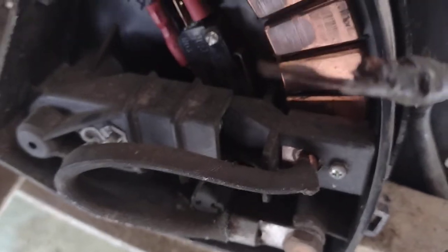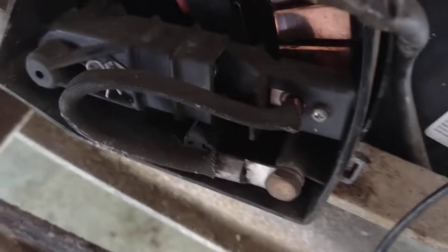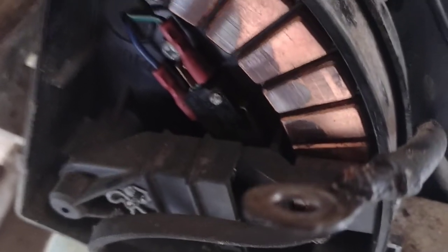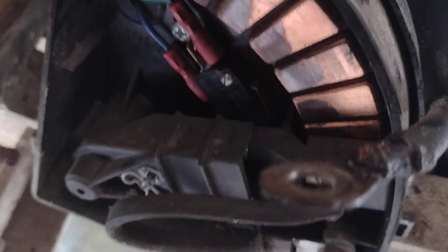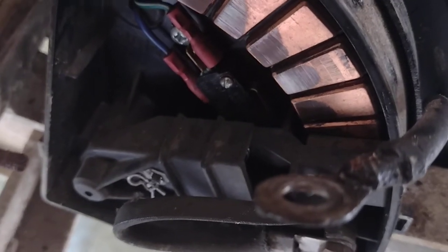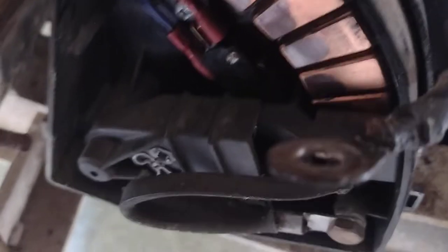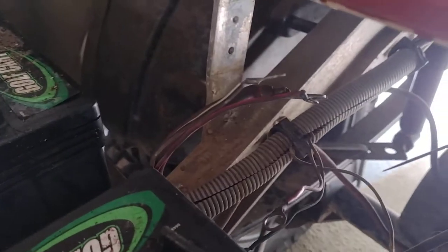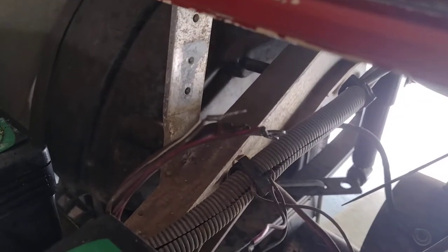...the micro switch right there. I can't do it with two hands, but if I move that brush or whatever you call it out of the way, I can reach my hand in there and it's not working — it's not even moving, it's not clicking. The no-click when I press the pedal — I'm used to hearing one click here and then the stronger click over there where the solenoid is mounted.